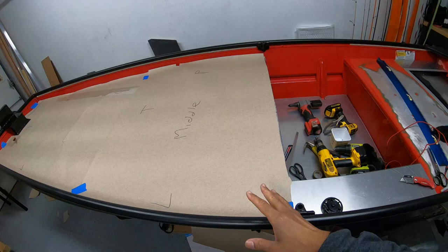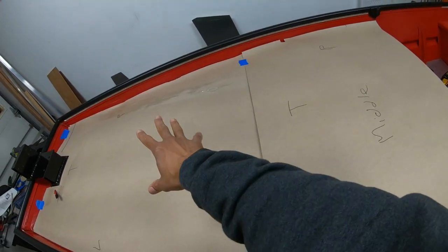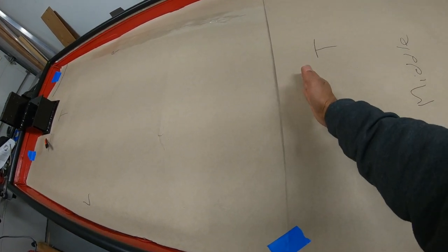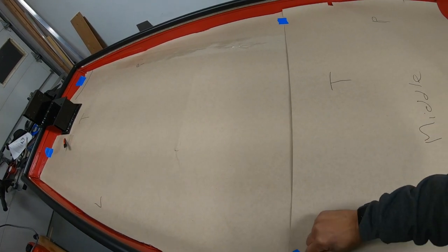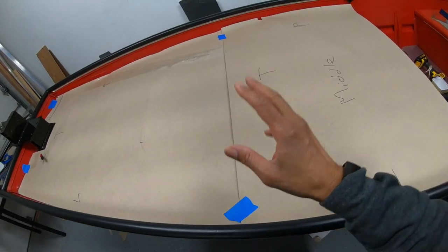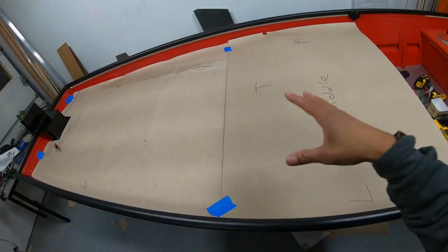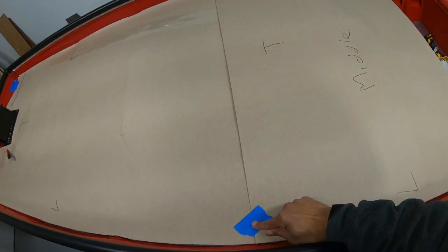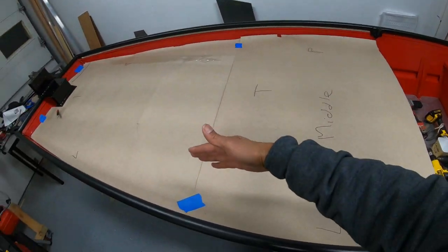I went ahead and cut out the template for the middle deck area as well. I figured my best bet for having a good joiner on the two sides is to cut both pieces — the front piece and the middle piece — and overlap them. I'm going to overlap one piece over the other and then make my cut through both pieces at the same time. That way I have a uniform cut for both the front piece and the middle piece of the hydroturf. I need my joint to be fluent — I don't want any gaps. Overlap it, cut through both. Of course that means I have to be super careful when I lay the piece down to make sure it is in the exact position it needs to be so that the edges line up perfectly.